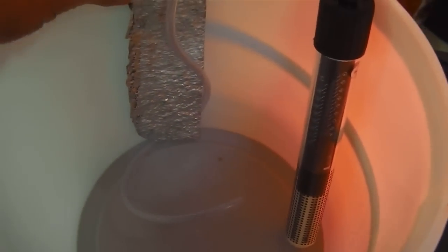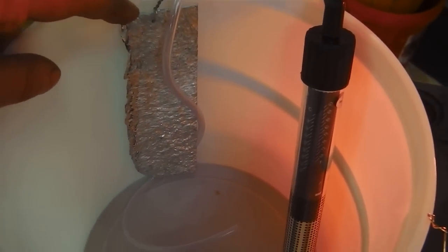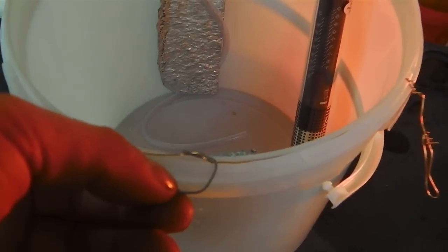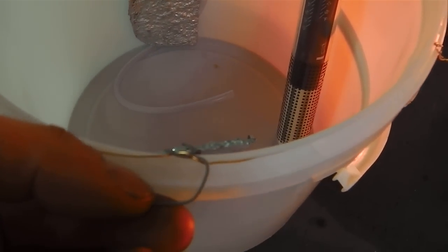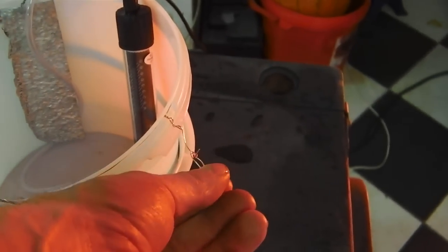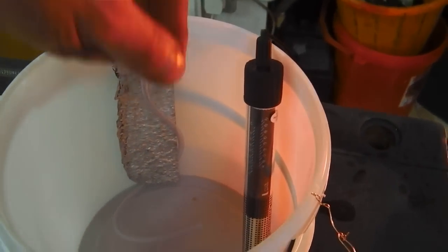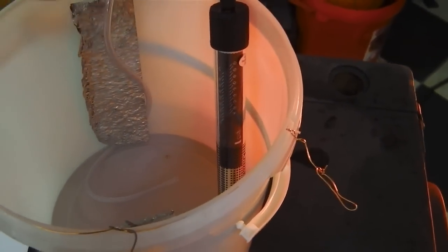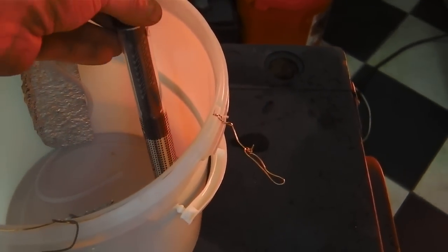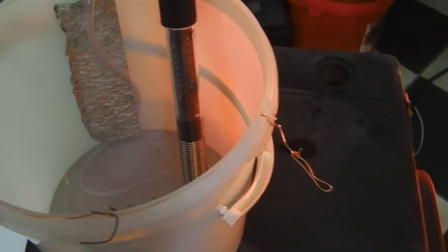So basically, hang those zinc plates with the wire that's supplied. I think they're using a titanium wire or something like that. I didn't quite read it, but hook them round. There are little holes already drilled in them, and then you hook them onto the wire so it makes electrical connection. That wire's going all the way around the top, and then it's going to have a hook up there for a power pack. And the bit that you're dipping is also connected to a bar, which you'll see in a minute. I've got a heater in it. That doesn't come with the kit. That's an aquarium heater. I'm going to run it at 25 degrees.